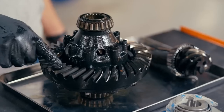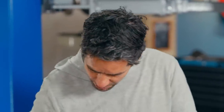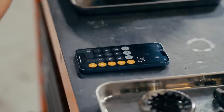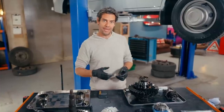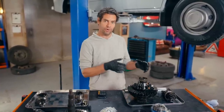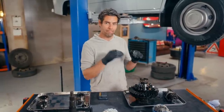The ratio comes from the ring gear — or crown wheel — and the teeth on the pinion gear. The 5.8 to 1 is derived by dividing one by the other: the crown wheel has 35 teeth, and dividing that by the six teeth on the pinion gear gives 5.83, which we round down to 5.8. That means for every 5.8 revolutions of the prop shaft, the road wheels turn one revolution — decent acceleration from a standing start, but top-end and motorway driving is highly limited. By lowering the final drive ratio, we'll get a higher top speed and make it much more comfortable on modern roads.